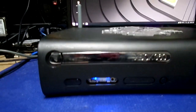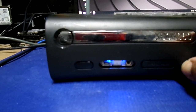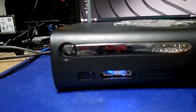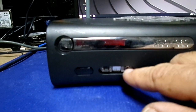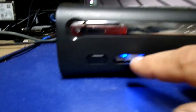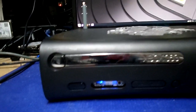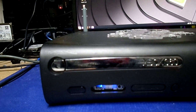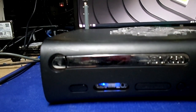It's in the hacked image right now. To select your regular standard NAND, just press the button right here — there's your standard NAND. Press it again — there's your hacked NAND. You can also do it from the front. That little port you can plug a USB stick into or plug a USB cord into your computer. If you've got a JR Programmer, a Demon reader comes up and you can directly read and write the NAND right through it.